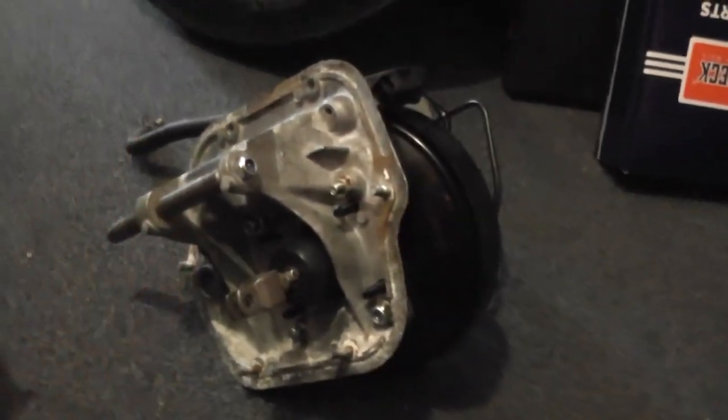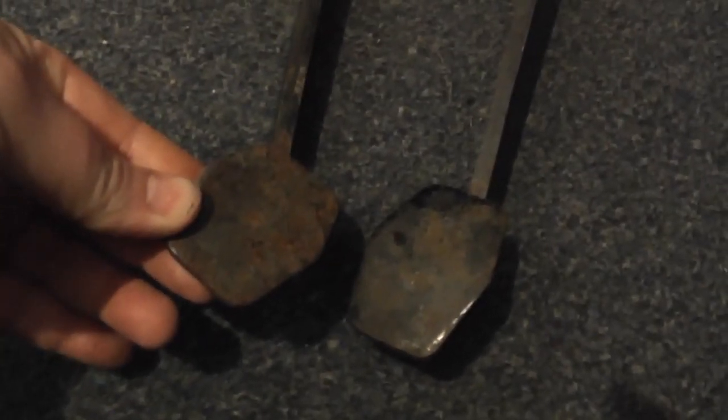And as for the brake pedal, at this Tippex mark here, it bends that way. So all you need to do is bend it the other way by about 110 degrees, is what I measured there originally. So I've now got the pedals back, and so I'm now going to bolt them back onto the pedal box and see if they fit properly in the car. You'll also need to cut off and re-weld the pedal pads at the correct angle, because they're now all skew-iff.